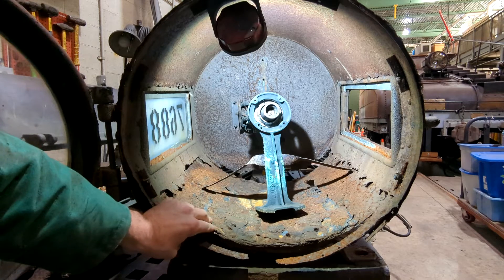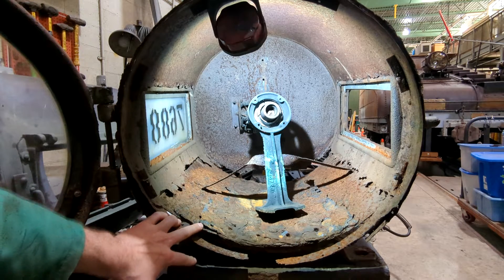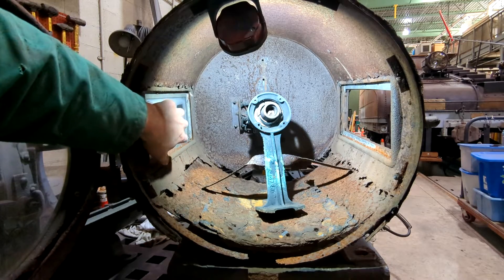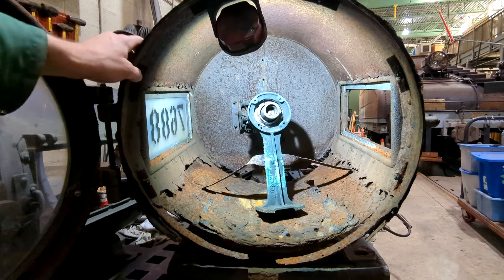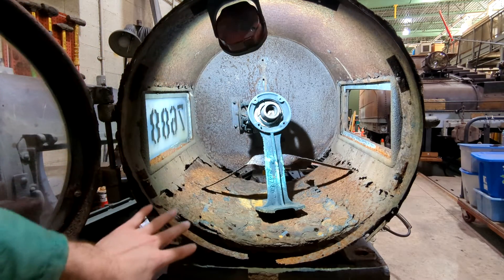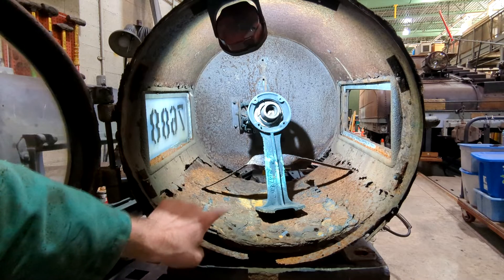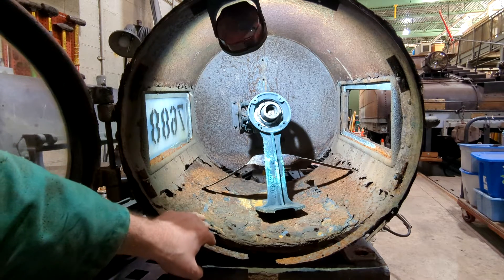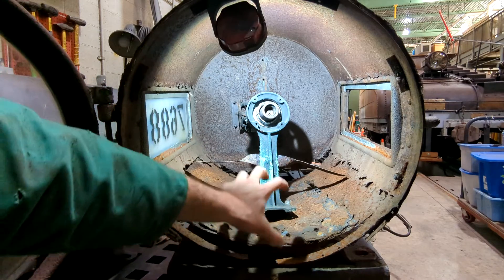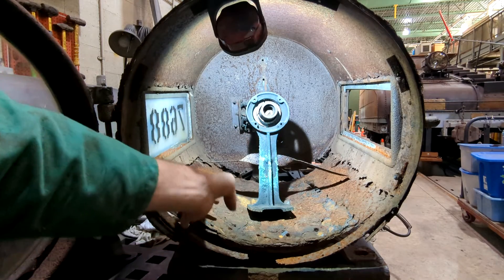These headlights had a problem: they didn't have any way for rainwater to drain out typically — no dedicated drain hole as they were built. You also have a lot of areas for water to get in through the side number plates, through the front seal, and also through the back where the screws mount the electrical hardware for the light itself. You can see that on this one the barrel is almost rotten away right here. This is actually made up of three pieces of metal: there's the barrel, a plate that goes on top to support it, and a piece of metal that acts as a three-point harness to mount the bulb itself. So most of the time these are pretty well shot.